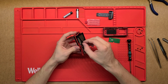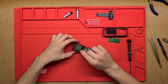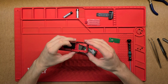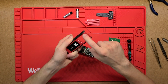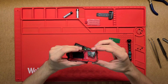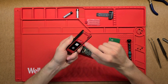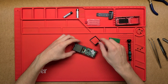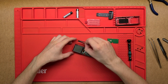Around the screen there's also a little bit of rubber. I'd assume that pressures down against the case and holds it in place — and maybe provides some environmental protection. The window here is translucent plastic that's glued in place and held in really well, so I doubt any moisture or dust could get through. This rubber is probably just there to sandwich the screen together and hold it nicely in place rather than act as a seal.